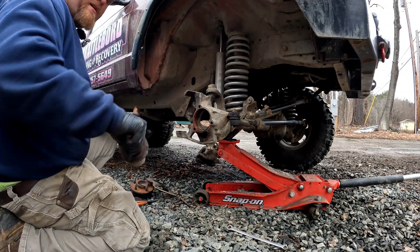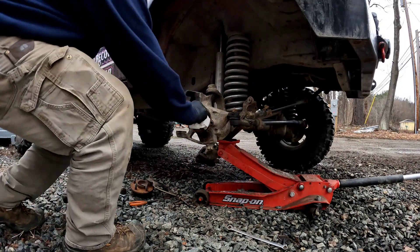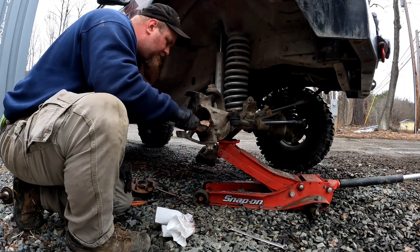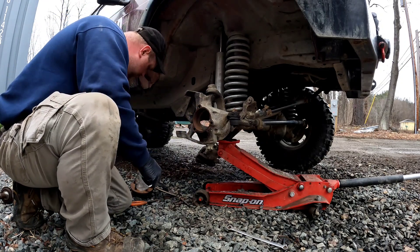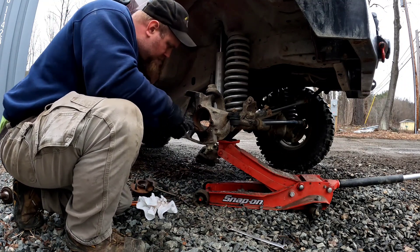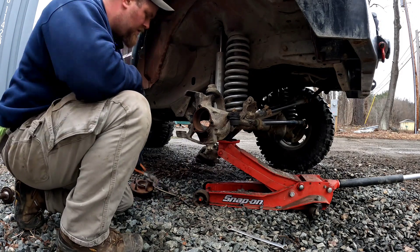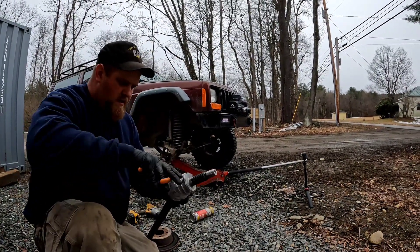Save the vacuum plate and pull the axle out. We will definitely save this axle for a spare. From there, we'll get a towel and clean this inner hub up. We need something to scrape all the loose debris out. You really have to watch out if you use sandpaper or anything to clean in here — a wire wheel wouldn't be too bad, but you don't want to take too much material off because the hubs kind of need to be a tight fit. Here's our new axle shaft.